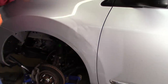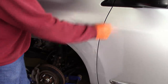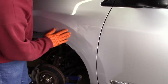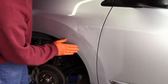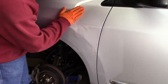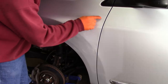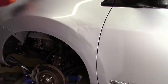I hope that makes sense. At this point the plan is I'm going to mask off the door, put a couple layers of tape on there, and then take my sanding disc and break through this paint. Anywhere that it's completely cracked I'll go through all that. Otherwise I just want to scuff this up and make it so the filler will stick to it. There's a little bit of deflection right here that I got most of out, but it's going to take a little bit of filler to shape that as well.